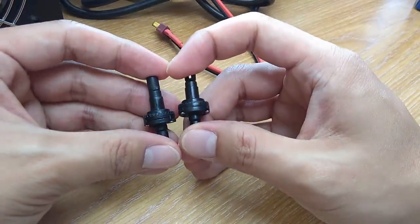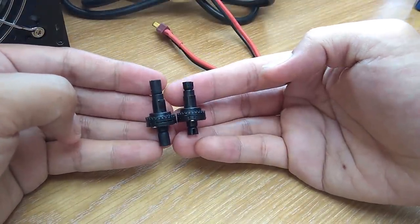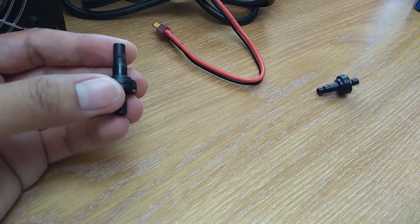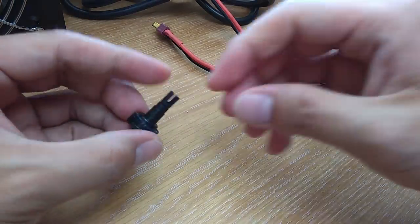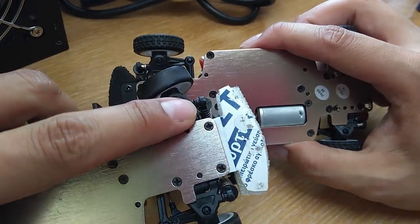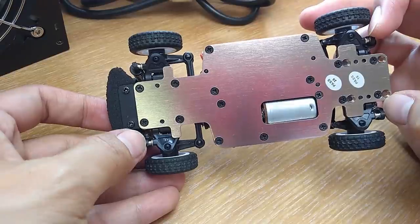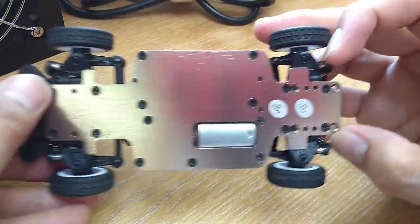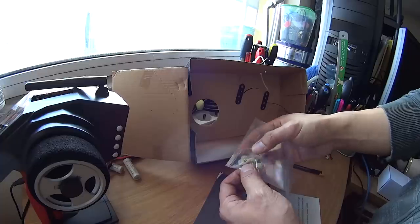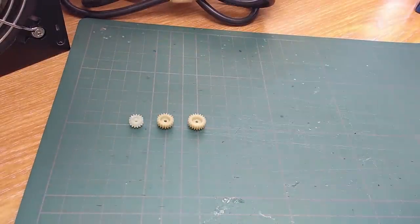The differentials are gear diffs, almost the same as Mini-Z. However, since the car is wider, they get around this by extending the drive cups, making them somewhat a weak point because they break easier than shorter drive cups. Another difference from the older model is the lower suspension arms now have metal ball heads, making the suspension much smoother. Finally, the package now includes reduction gears — 15T, 19T, and 21T pinions, a 27T spur gear, and a rear gear for 102mm wheelbase.